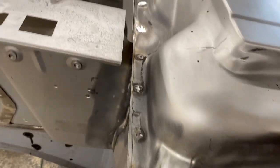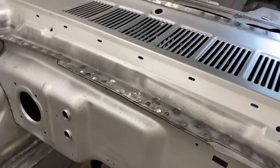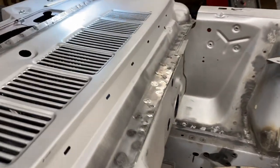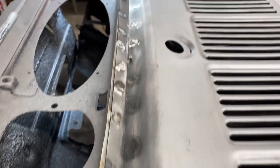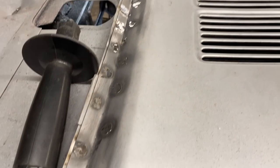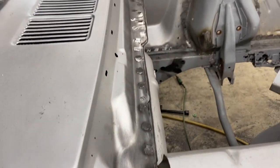Here's what it looks like after the next step with the top of the welds ground off. You know, I read online a comment that now rings a whole lot more true. I tried to get good at welding, and what I did was I got good at grinding. 129 welds, and they're ready to get hit with a belt sander, and then finished up after that. Only found one that had a little hole in it, so I tacked that full, and happy the way it's coming out.